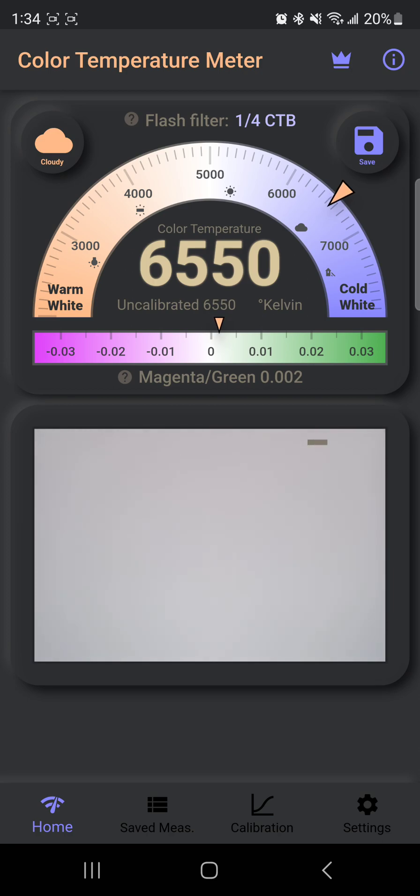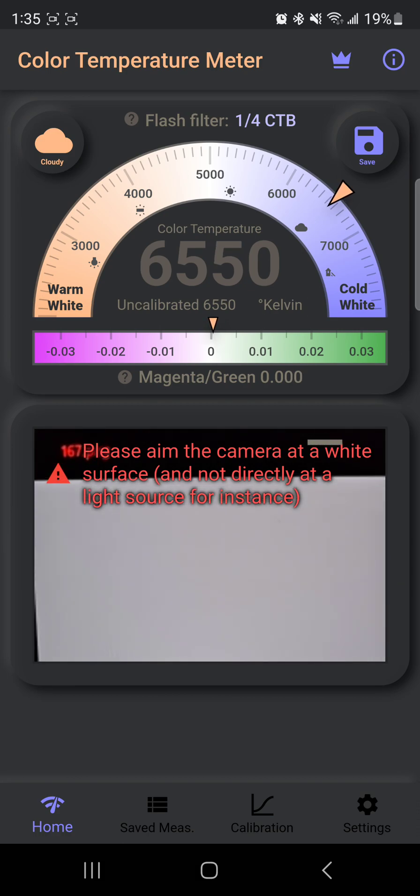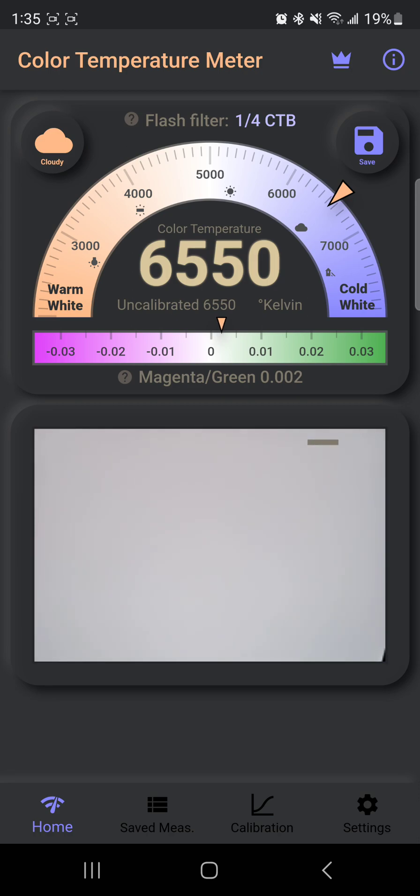Of course this isn't truly accurate — I'm just throwing a rock at D65 using my eyes. For exact D65 you need XYZ coordinates. Use your eyes to determine the best option. Try all the calibrations in the description specifically for the SDR/HDR trick, see which one you like most. If you want to calibrate for native HDR, just skip the near-black adjustment. We're already on picture 167 and hitting ABL — 6500K, 0.002 magenta-to-green. Let me know if you have any questions.